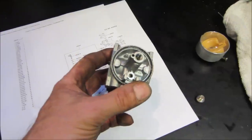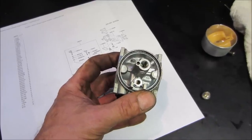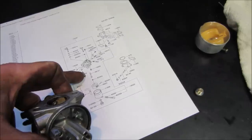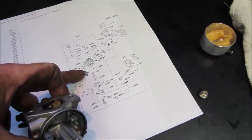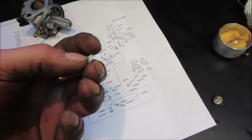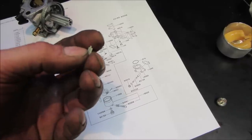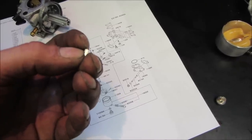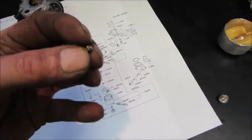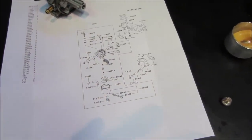So what we might do is take the cute old Q-tip in the drill and some lapping compound and maybe try to polish that guy up inside there, or we're gonna look in the hoard, see what else we have for needles, and see if we can find one that is maybe a little bit better. And I also do think that the pin on this sometimes does not seem like it travels all the way up. Maybe the spring on the inside is a little on the weak side. No, I'm gonna come up with something.